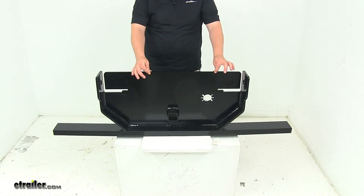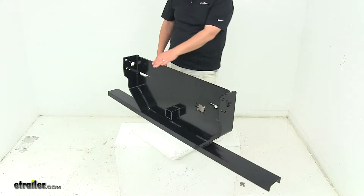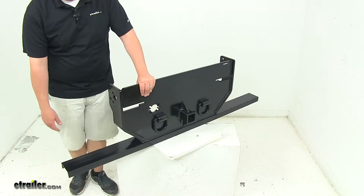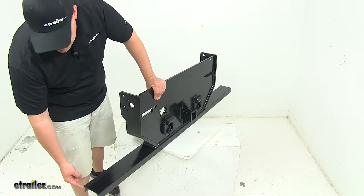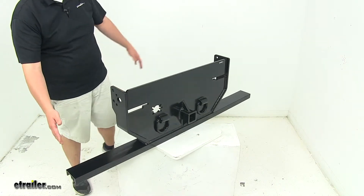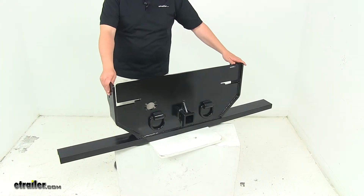This is a half-inch thick hitch plate, which includes the ICC bumper protection — that's the long bar here at the bottom. This is a C-channel design that measures four inches front to back by sixty-two inches long from edge to edge.